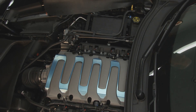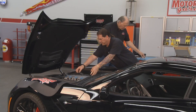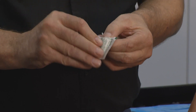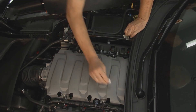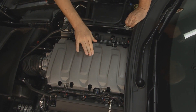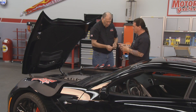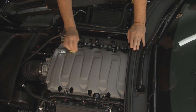Once you get it shaped, the next step is to prep it. What comes in this kit is just some clean wipes. Regular rubbing alcohol — household alcohol — works perfect. You want to scrub it, make sure there's no residues. Get into these cracks real good so that it makes a good bond. Then you'll apply the 3M adhesive accelerator — this is what's going to make these parts bond onto this hot motor permanently.